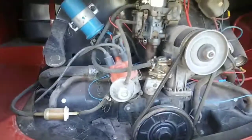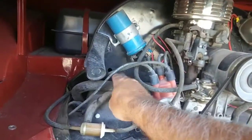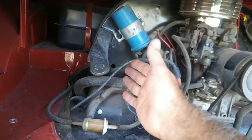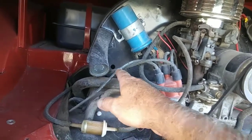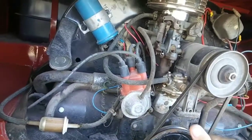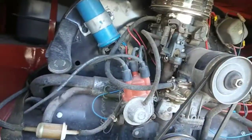There's another thing that you want to remove. I forget what it was called, but there are little flappers in some of them. Mine are all gone. I don't have any of those in my fan shrouds. Original VWs have them, and every time I see one in there, I just take it out automatically, so I didn't think about putting this in the video the first time. There's a flapper with a rod that goes down into a temperature thing. Take all that out. Goodbye. If you have those little flappers in there, just take every bit of that out.